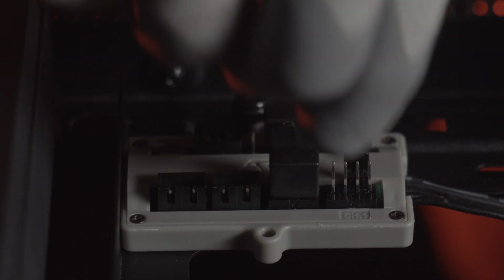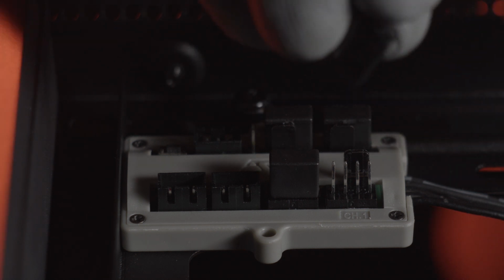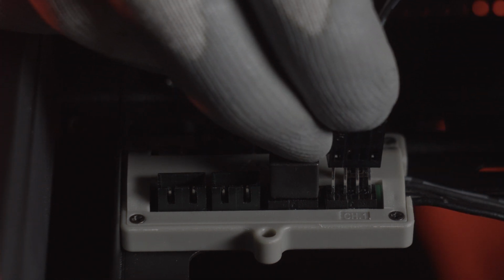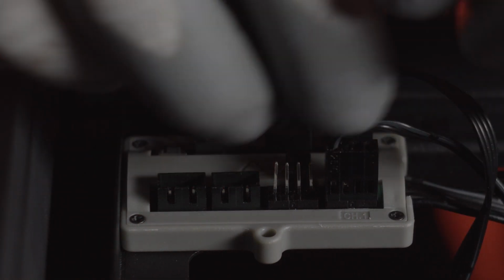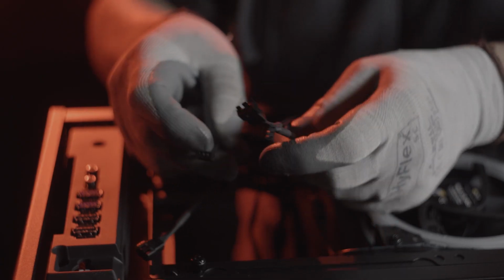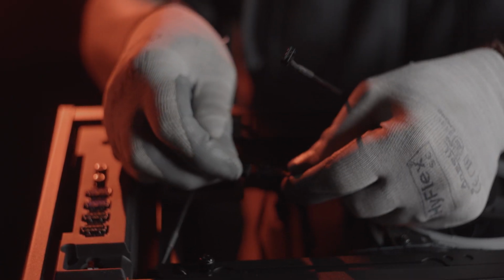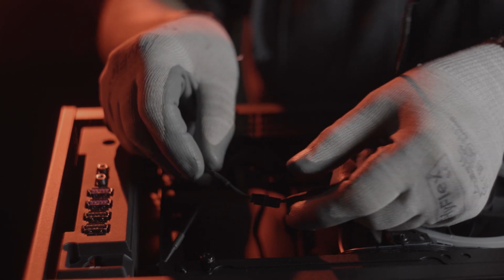Before you connect any fans or LEDs, be sure to first install the signal wire for the water pump. This plugs into the connector labeled Channel 1, which is covered by a red cap distinguishing it from the other connectors. Install the remaining fan and LED cables. The fans use 4-pin connectors, and the LEDs use 3-pin connectors. The Iris LEDs on the fans can be daisy-chained together.